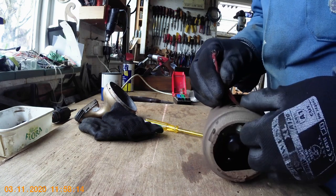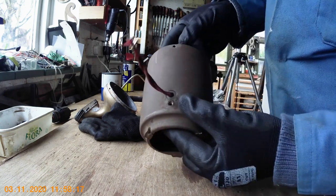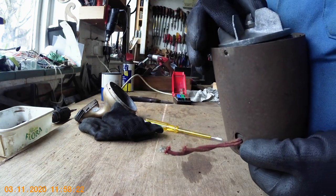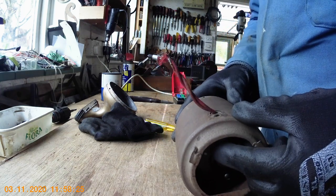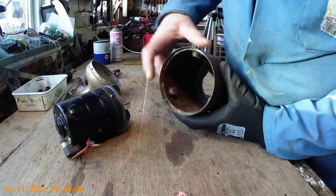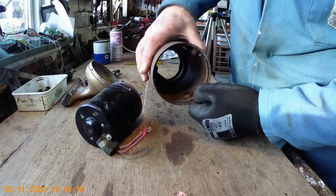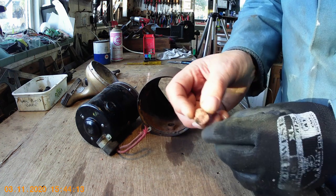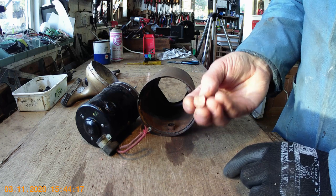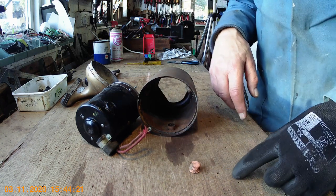You've got to poke this through, pulling the wires out, until you get to that little bit so you can screw it in. You've got to make sure this isn't wobbling about. We've got a problem with these little bushes around here that keep the motor in place. I've taken one out — they're worn down flat. Somewhere in my boxes I've got some of these actual bushes — new ones — but I've searched around and I can't find them, so I'm going to have to fashion something else.